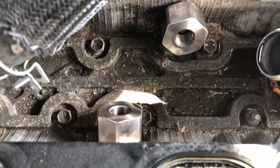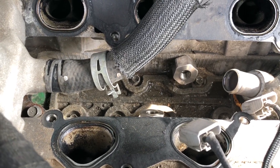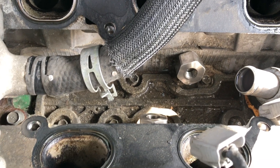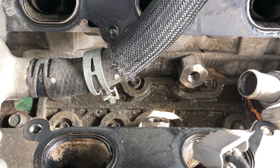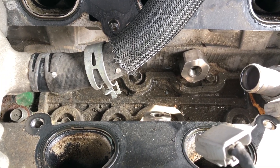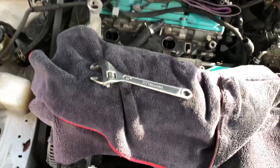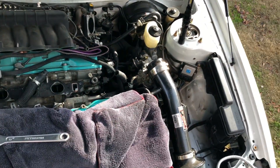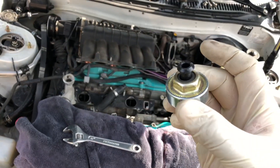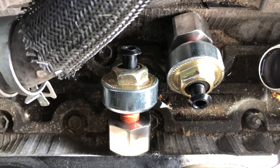Got the first part of the knock sensor installed. ATS does not torque the knock sensors down to the adapter from the factory, but they do recommend you torque them down to 15 pound-feet. For reference, Honda valve covers are torqued to 16 pound-feet, so I have a feel for that range. I don't have a socket big enough to properly torque these down in the space I'm working in, so I'm going by my best knowledge of what 15 pound-feet feels like.